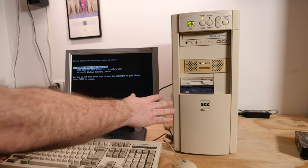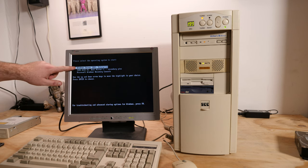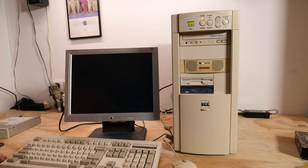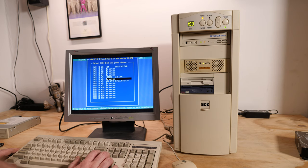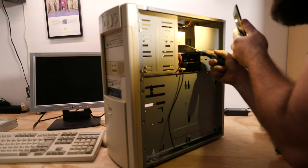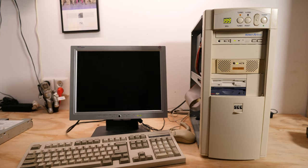This is a much better sound level, and now the case is even open, so when it's closed it's just perfect. Oh, there's Windows Server 2003 on it. Let's see if it boots. Okay, at least it reboots. Okay, that installation is broken. The Plextor is not found. The jumper is not on the ID setting, but on parity. I was thinking it was on ID 6, so let's change that. Okay, solved. Bootable CD-ROM detected.